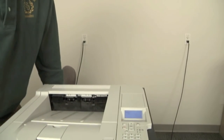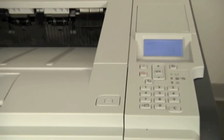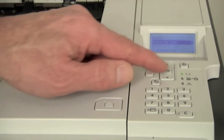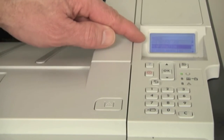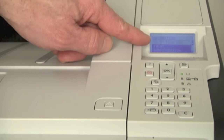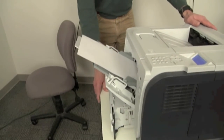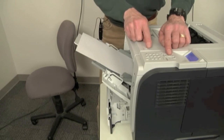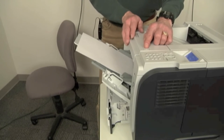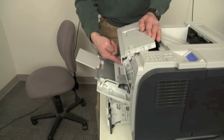Looking at the control panel — I'll zoom in a little — I go through, it tells me Tray 2 is open, I dismiss that, go down to the information menu, click OK. I usually print the configuration page, but you can choose whichever you want. You can even send a print job that replicates your image defect — a gray page, black page, or pure white page. When I press the button, it starts running. I need to be ready to open up the door quickly. Press the button to print, watch the paper feed in, and stop it. I've stopped the machine by opening the door, and the trailing edge is right here on this particular machine.